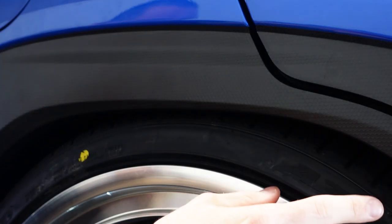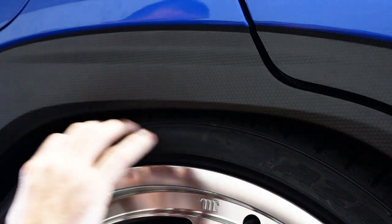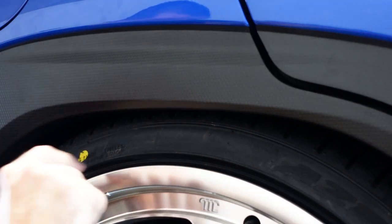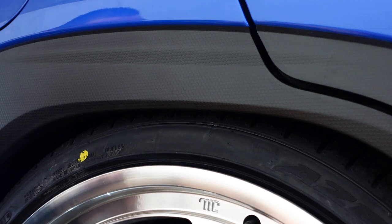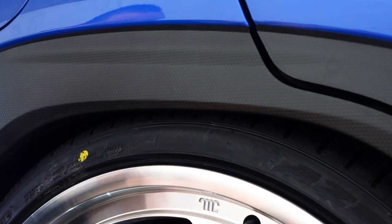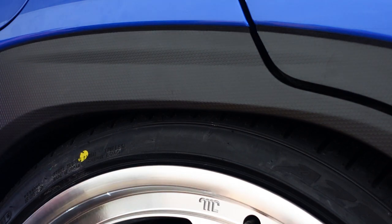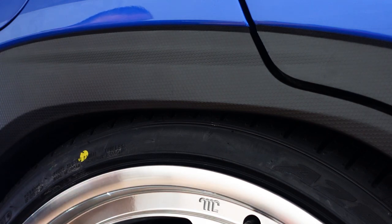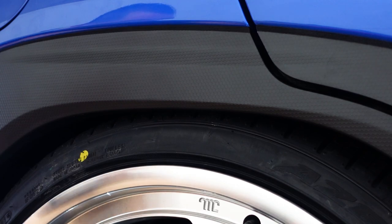The back here is a slightly different story. We have this 20-inch wheel, same thing — 235-35 all around — and we have pretty much the same camber in the rear as we do in the front. We are still on the stock control arms and toe arms, and we have not gotten the car aligned because we're going to be putting multiple sets of wheels on it. However, you could do control arms, toe arms, and adjust it how you need. We have maybe one to one and a half degrees negative camber back here, pretty much matching the front.